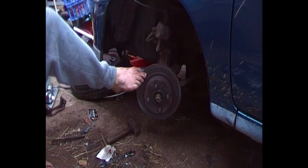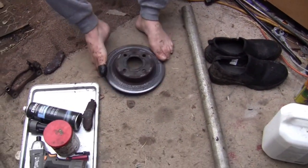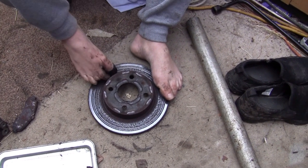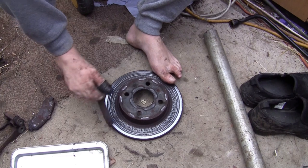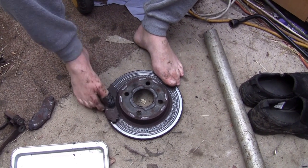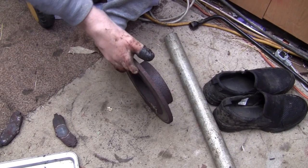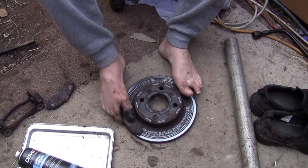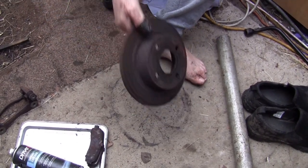Now we're taking off the disc stage. In America they call these rotors, but over here we call them discs. As you can see the back's quite clean but the front's a bit pitted — this is from the weather. Because the car's been sat, the pad's pushed down on this, and this would eventually clean up because that's your pad rubbing there, which is what causes the car to brake. The back one's always cleaner because the piston pushes the rear pad in and then squeezes the whole thing together. Probably 50 miles and it'll clean up, but my customer requested brand new ones.